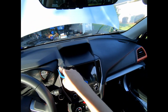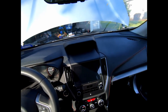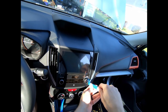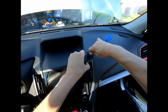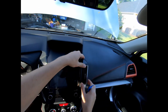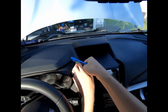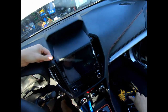Next I'll show you how to remove these plates here so that we can remove our stereo units and splice into or tap into the wires of the harness. I'm going to take my pry tool — up here is the best spot to unclip the top. Pull towards myself. You want to hear that clunk noise because there's some blue clips back here that hold it. It pops out — you can see there are four clips holding it. Do the same on the other side, wiggling it helps.